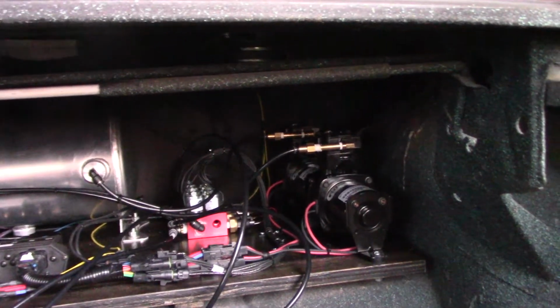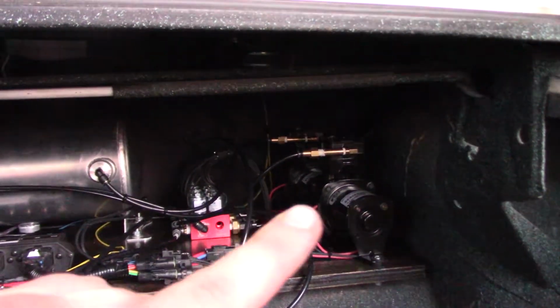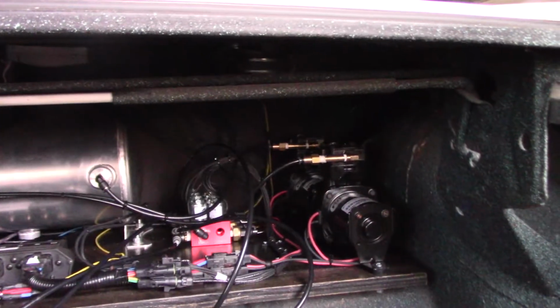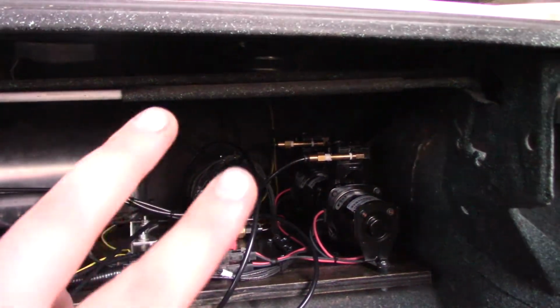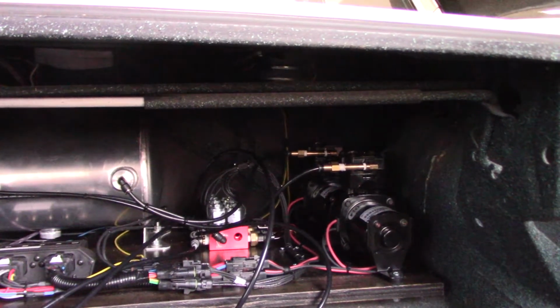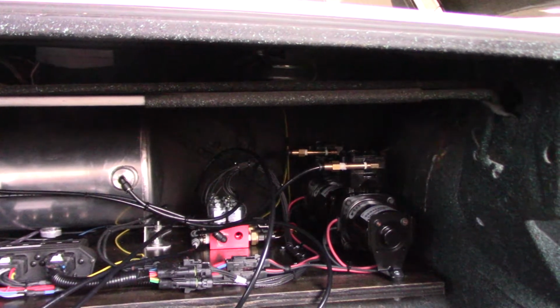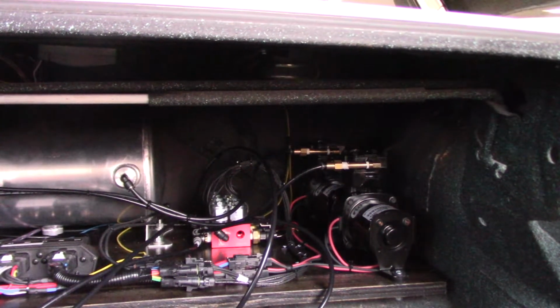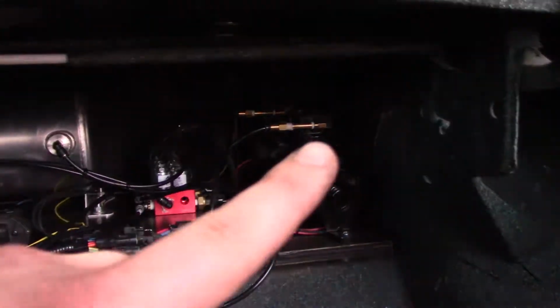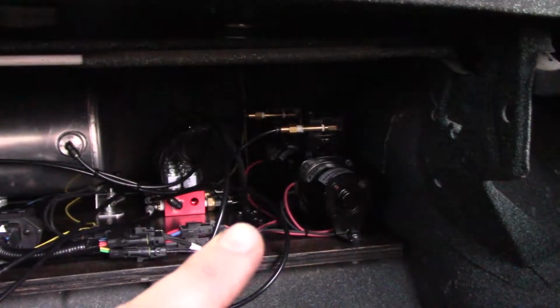The compressors, I had plastic 90-degree push connects right off the top of the compressor. They actually, both of them at the same time, blew out the first time I pumped this thing up. I think it was a combination of heat and vibration. So I went to the hardware store and got some 90s, which it didn't come with. The kit didn't come with those.